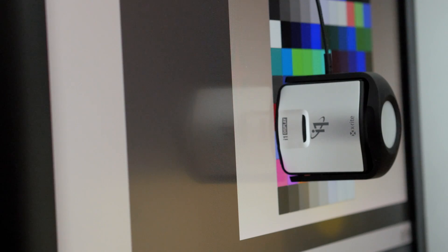As I mentioned, the first thing I noticed after my first calibration was that it looked really dim, and secondly the colors weren't as nice. What you're trying to do is limit your monitor's output to meet the sRGB standard, so that as you do your work you can understand what it's going to look like on the majority of computers out there. Yes, it will look a little different, but you can switch back and forth. If you just want to do regular desktop use with a wider color gamut, you can do that, and then when you come back in for color grading or correction, just switch back to the profile the X-Rite i1 Display Pro made for you.